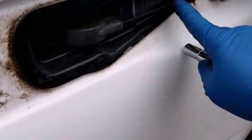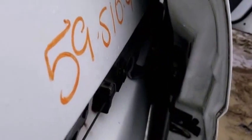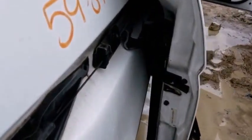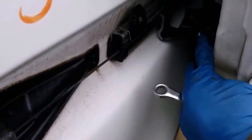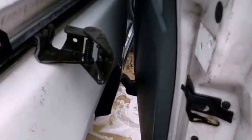There's the sliding door motor cable being exposed. The next thing at this point will be to disconnect the roller assembly from the sliding door, and we'll do that with a number 12 millimeter wrench. It would be a good idea to make sure the door is resting on something when it eventually comes off — you might use a jack or anything that will keep the door about the same height. The door is held in place by two 12 millimeter bolts.